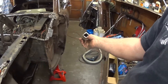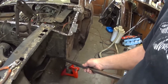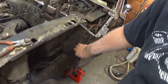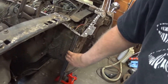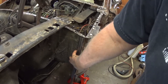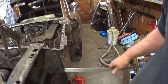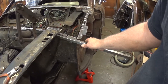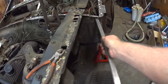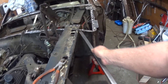Maybe it's specked out at 65, I don't know. What I want to do is, after the torque boxes are in, I'm going to weld in this piece so it'll be spot welded through the pinch weld this way and through the firewall on two sides. It will actually be an assembly where there's a curved piece that welds in right here, so it'll be a solid piece that goes from here down to the front of the torque box.